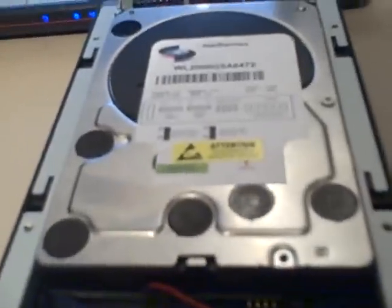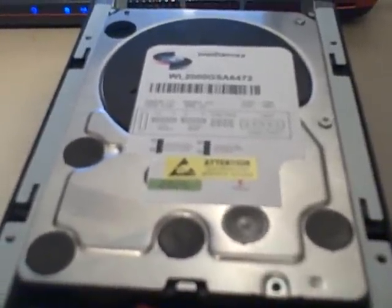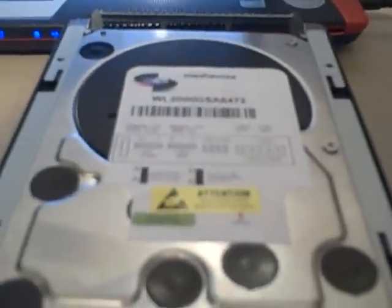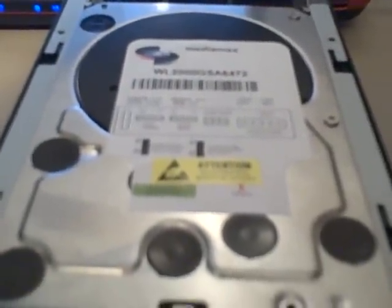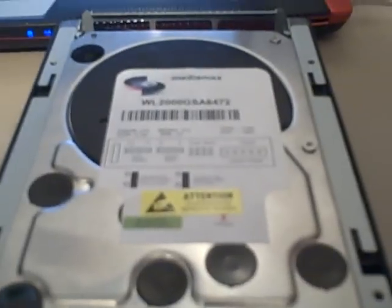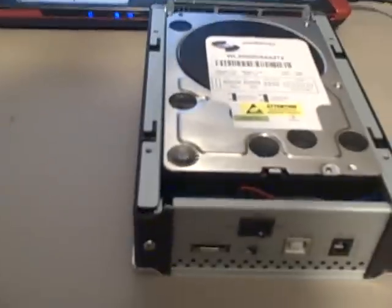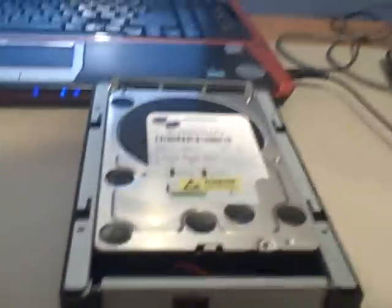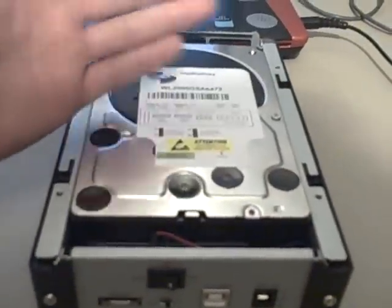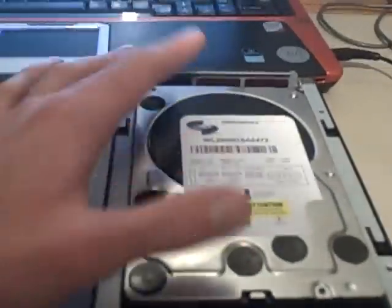If you have a 150 gigabyte Raptor, this would at least be as fast as it with IO, or close to it. On the cons side, the power consumption: the drive takes 8 to 9 watts when idle and up to 12 watts at full seek — just full back and forth from first track to last track. Typically it would be somewhere between 8 to 11 watts.